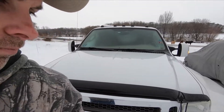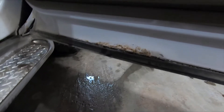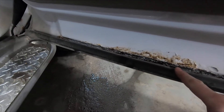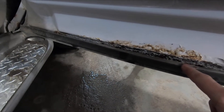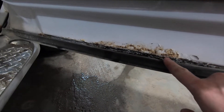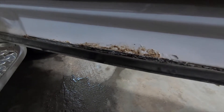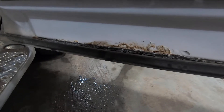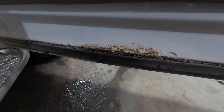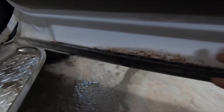Alright guys, we are inside now and the truck is thawing out little by little. We've got both the passenger and driver's side doors with some rust starting — mostly surface rust underneath this trim strip. I want to take it off, scuff it back, get rid of the rust, and then hit it with POR-15. I'll put the link below. It's a rust inhibitor and preventer that comes with metal prep, some cleaner, and a rust-preventative gloss white paint. After that I'll pick up the proper Oxford White Z1 paint code from Automotive Touch-Ups to clean up the bottom and make sure it's properly protected.